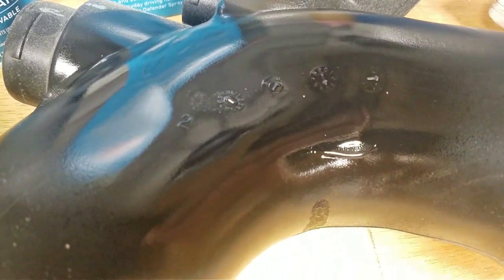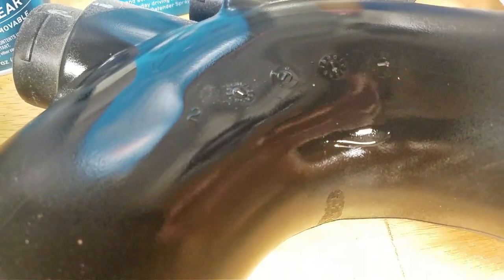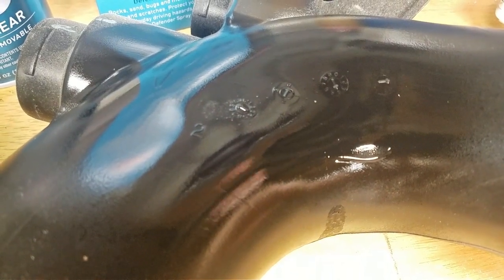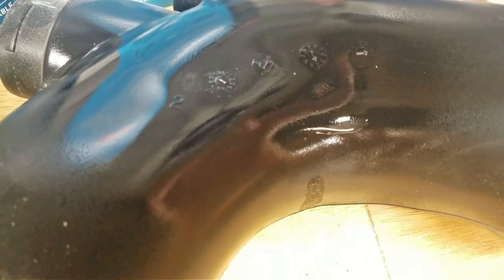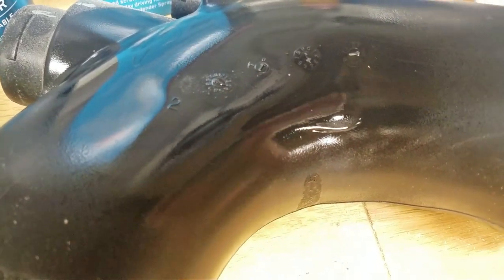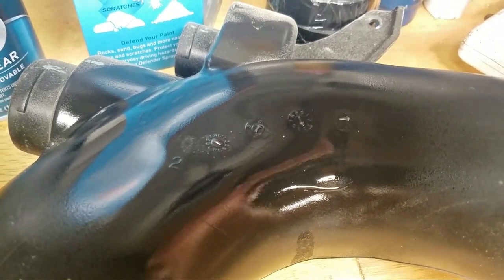The other thing is that when you spray, make sure you spray evenly. If not, there are going to be some highs and lows to the finish, which creates an effect you don't want on your car. So that's probably why the poor reviews come in. It's because of the way you're spraying. Having high and low spots on a car really affects the way the light hits it, so it doesn't really give that attractive finish to the car, especially if you do the lip of the hood.